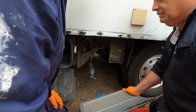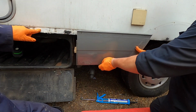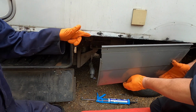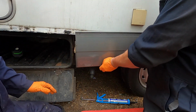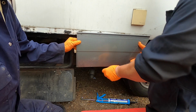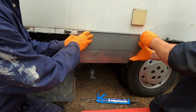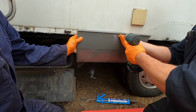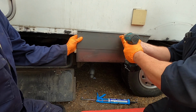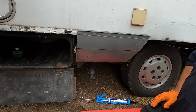Right, so now we're just going to start putting the trim on, and we cleaned up the old mastic, got rid of that, and now we mastic it up and then screw it back on. Right, sure, I'll get that. So we're using the original holes, but new screws. We cleaned and removed the mastic from all the trim, or so we thought, because we soon discovered we were missing a piece. Right, and the next one, please. And the next one's...